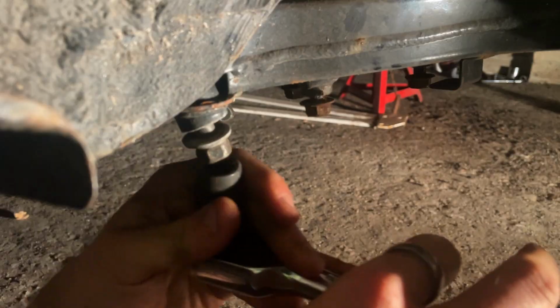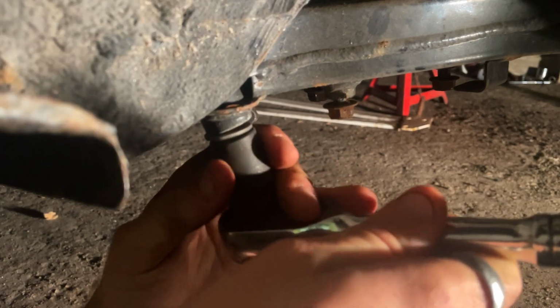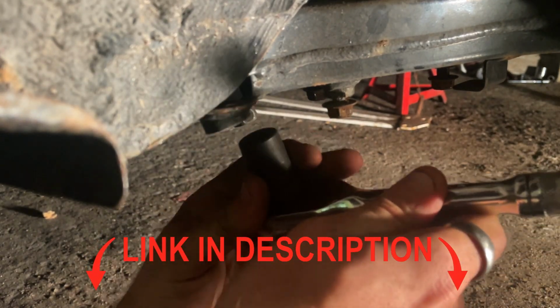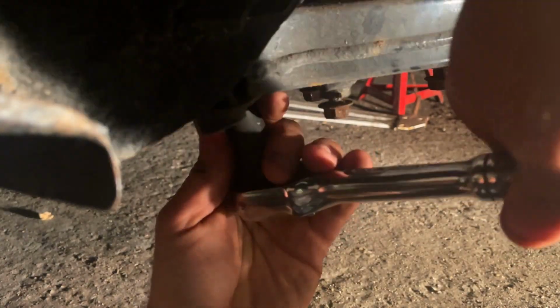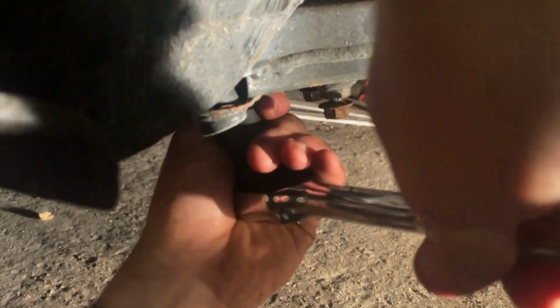Now moving on to the kidney brackets, and I can't stress enough how rusty these can be. I've replaced mine before. I do have a video on the channel and I'll leave a link in the description so you can see how to do it, but take your time with these. There's 2 14mm bolts at the front and they have a chance of breaking, and even worse, just spinning, so take your time.